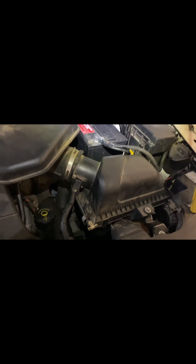Got everything back together — not that there was much to take apart. The only thing that really had to come out of the way was this intake box right here. There's no screws other than this one right here. I ended up just taking those two 8mm slash 5/16ths — whichever you want to use, they both work the same. Unplug, then use that same 8mm or 5/16ths on the clamp and the back clamp — intake's out of the way, no big deal. I just disconnected the battery, but everything's back in place and screwed down.